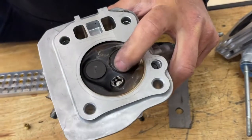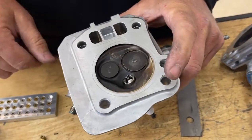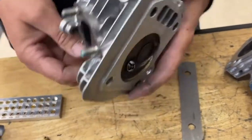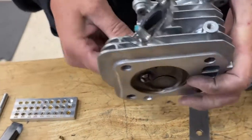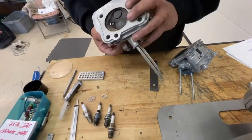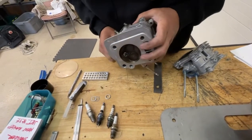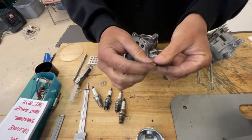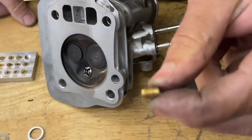You can drastically increase compression with different length spark plugs. Now let's go into one more topic, which is jetting. This is a standard jet for a Honda carburetor — it goes up through the center of the carburetor and has a hole in the middle, and we measure that hole with a pin gauge.